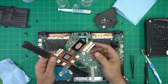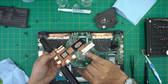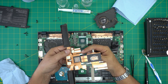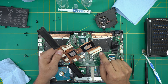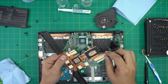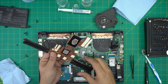Take note of the thermal pad sizes on the heat sink — there are 3mm and 2mm pads in various positions across the board, plus a small foil tape section. This is important when replacing them. Now we're going to take the heat sink outside.